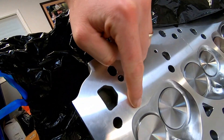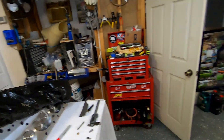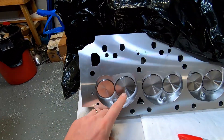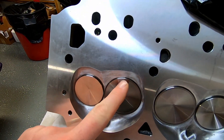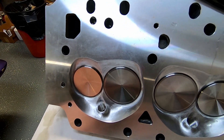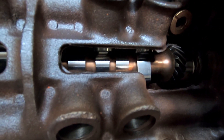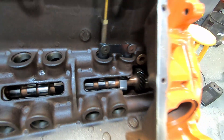We're going to get both those measured today, and that will give us a good idea of how efficient the engine is going to be. Also, when I check the piston-to-valve clearance, it'll let me know if I can go to a larger cam in the future — this cam might need to be upgraded. It is a hydraulic roller cam and I'm using solid roller lifters, so I've got those mocked into place.